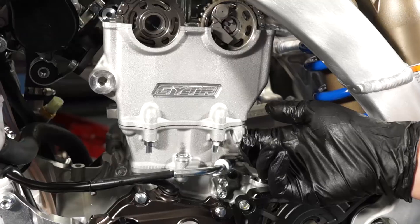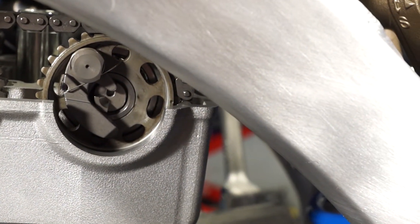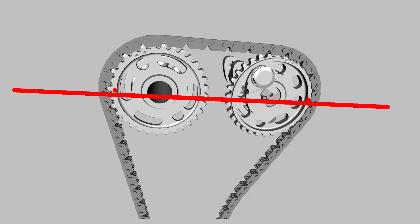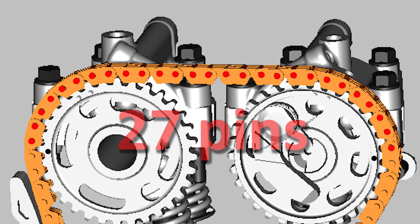Push in on the rear of the timing chain guide with your fingers and check that the top dead center mark is good and both cam marks align properly. Sometimes you'll need to remove the cams, move the chain one or more teeth forward or back on the sprockets, and recheck. A double check on proper cam timing is to count the number of timing chain link pins between the cam sprocket dots — there should be 27 pins on reverse cylinder YZ250F and 450F models.